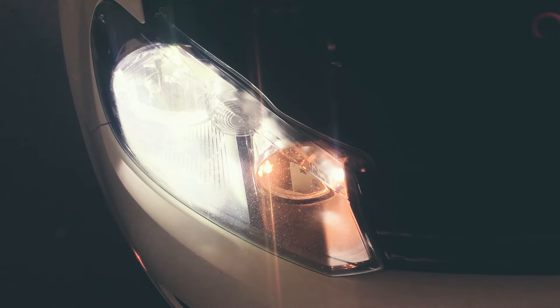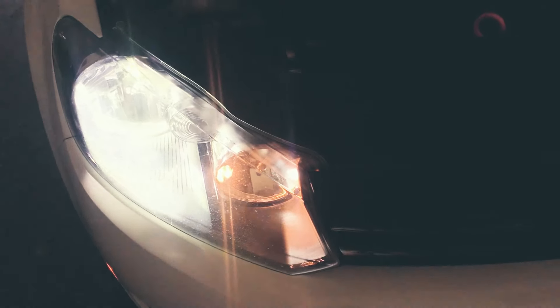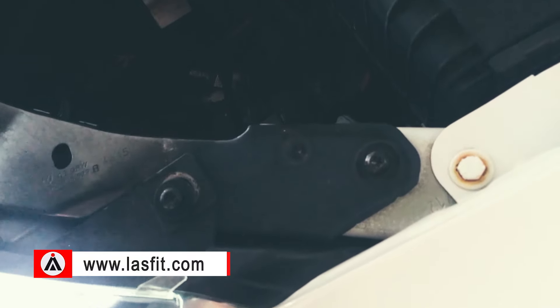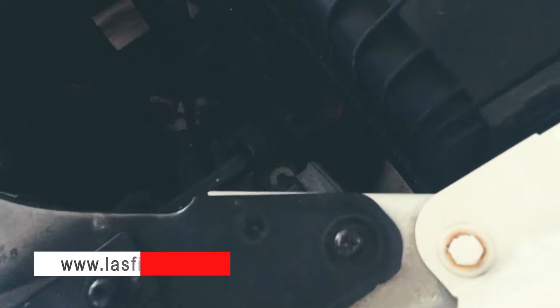Alright guys, just like that you're done. Just remember to put your cap back on and you should be good. It's the same procedure on the driver's side — it was a little bit more of a tight fit. Same way: take off your cap, reach for the bulb, twist it out, and put the new one back in. If you can't fit in there, removing this bracket should give you a little more space. Another option is to actually pull out the actual headlight assembly — that should give you room to get in there as well. Thank you guys for watching — I'll catch you in the next video.